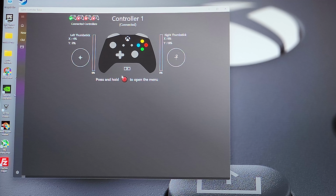Adding extra solder just helps keep it liquid long enough that you can pull out the potentiometer. And I just grab tweezers and work it back and forth. You get one side hot and then work back and then it'll pop out. And then I use a solder sucker to get the solder out. Works pretty well most of the time. These newer controllers, the solder pads are a little bit bigger, so it does typically work pretty well.